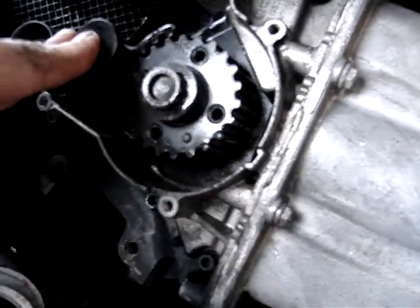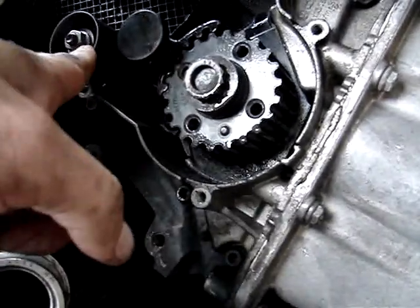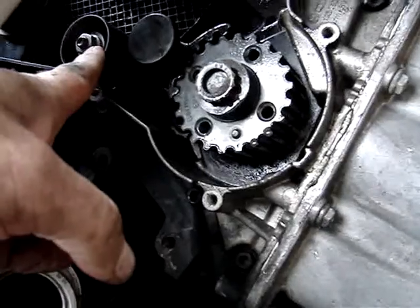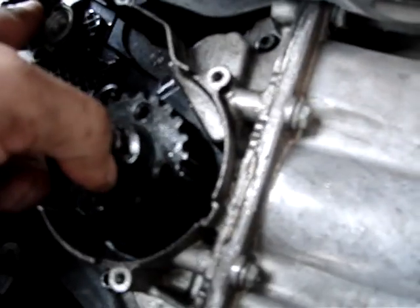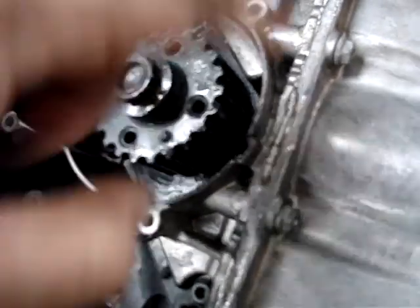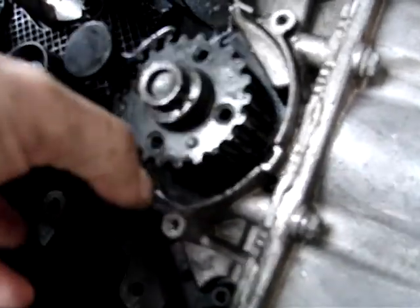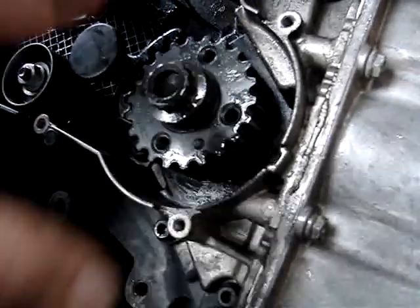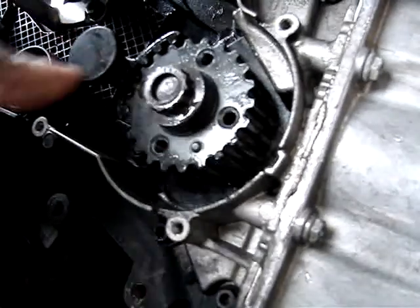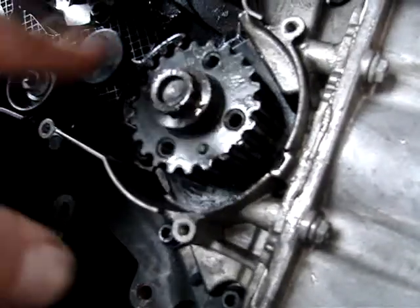We're still locked in down here, and the pin is still up on top, so we're at top dead center. The roller is 15 foot pounds. I'm going to start the belt down here, come up along the water pump and then up around the camshaft. I'll get this side as tight as I can and leave the slack on the tensioner side. When I release that, it should pull tight and keep everything locked up. If we're off a little, we can loosen the camshaft bolts — we have some play to do the final timing.